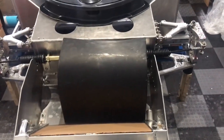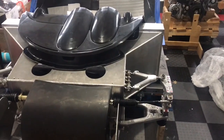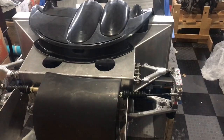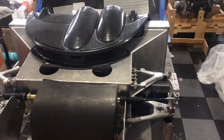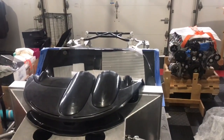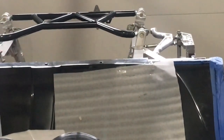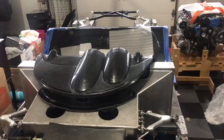Welcome back. This is where we're at on the super light coupe project. In this video we are going to do the initial suspension alignment for the body placement — setting ride height, zero toe, and zero camber so we can see how the wheels line up in the body and get the body centered. We're also going to install the bell cranks on the rear suspension, which place the rear shock absorbers in an inboard orientation — a design that really comes out of auto racing.